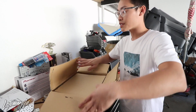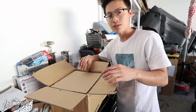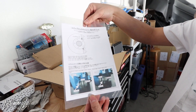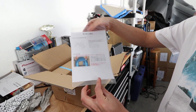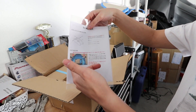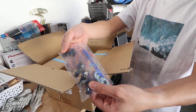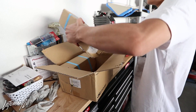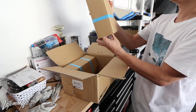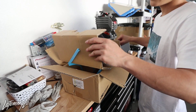I'm going to have a full install video on these. I cannot use my current rotors, which are 10 inch — I have to upgrade to the Mini Cooper ones, the 11 inch. First thing you get in the box is Japanese instructions showing how to bleed it — you start on the outside then move to the inside — plus the hardware and washers for the calipers. There are two sets in here.